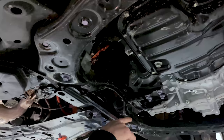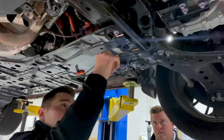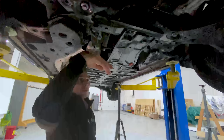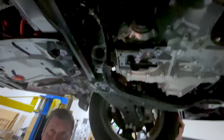So it's helping the cradle absorb some of that energy coming forward in the vehicle. As you follow that energy train rearward, you'll see some of the major skid plates on the underside have a keyed or slotted feature. During an impact, that allows this plate to shear off or separate from these bolts so you're not loading up the whole underside of the battery pack — terminating that energy transfer much further forward relative to the pack.